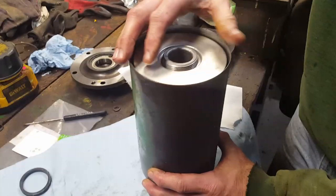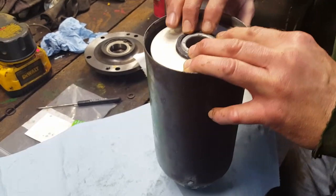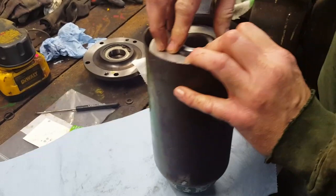The remaining seal goes on top. You can kind of hold the filter down against the spring pressure and work it down a little bit, get that seal down so some threads are showing. That way when you go to put it on the tractor you've got something to engage without fighting it too much.